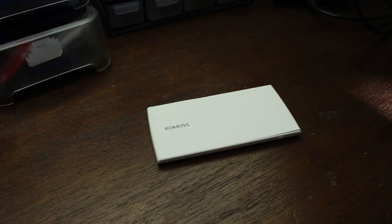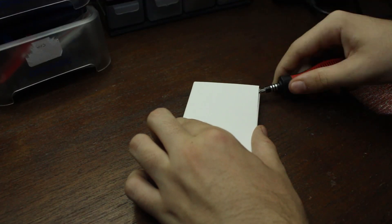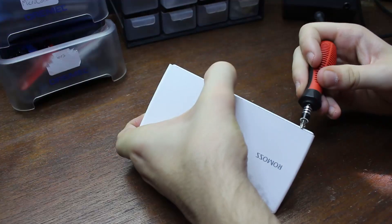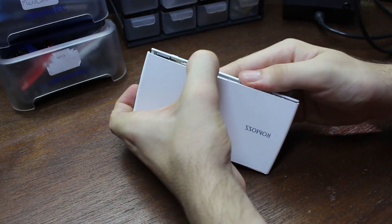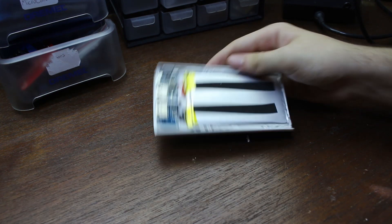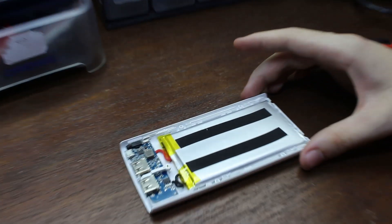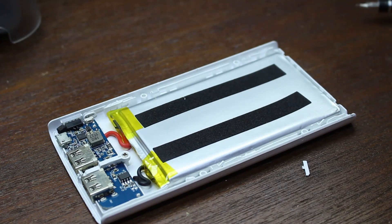This one you have to really take your time with. This is a lithium battery, which means if you accidentally stab it with a screwdriver while trying to pry apart the case, not only will you lose the battery, but you might also lose your house. So be very careful. I found that my battery was held together with a series of plastic clips which could be undone with a screwdriver. With the battery out, set it and the power management system aside for later.